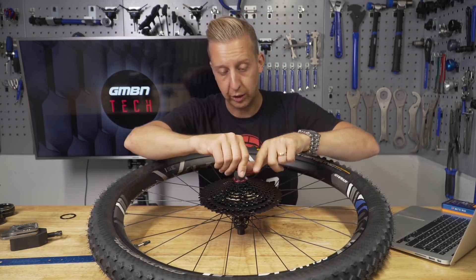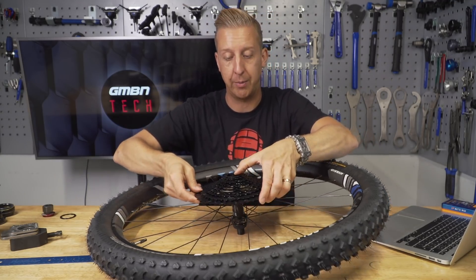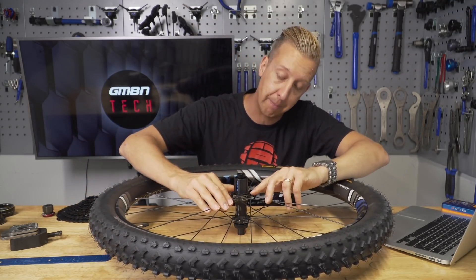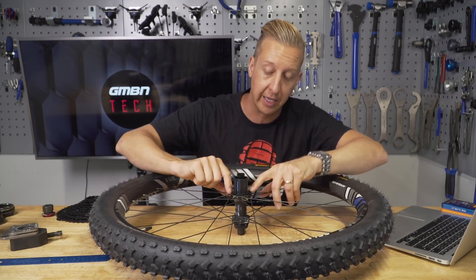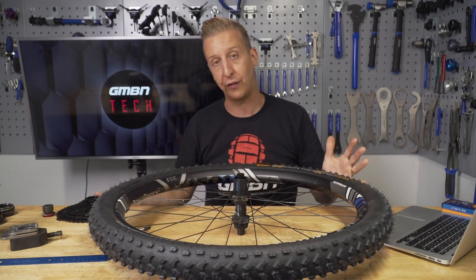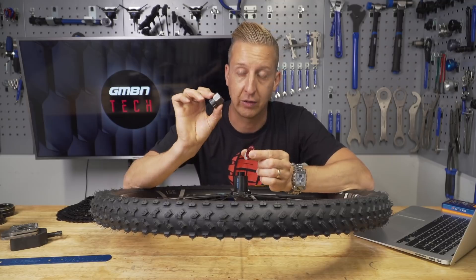If that's the case, you'll need to go and get one of those spacers. Also, if you've got all the correct spacers between cassette sprockets, it can sometimes still happen at the back — on some cassette body designs there's no step, and you actually need a spacer there too. If that spacer is missing the cassette will wobble slightly. So a few little things to check, but the basics are: you need a cassette tool.